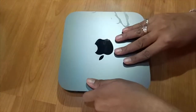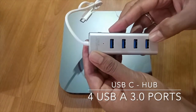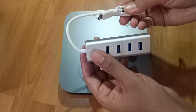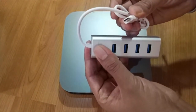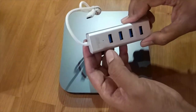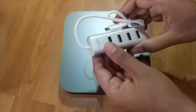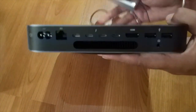I will show you a product I bought specifically for it — a USB-C to USB-A converter. These are USB 3.0, and make sure to buy something that supports 900mA per port, as some hubs on the market have a combined capacity restriction. This one provides 900mA to each port, so you can connect multiple hard disks and all your old peripherals that still use USB-A. Keep in mind there are only two USB-A ports on the Mac mini itself.